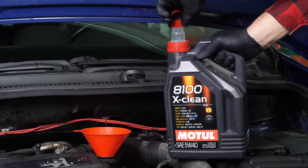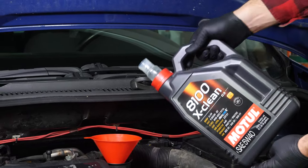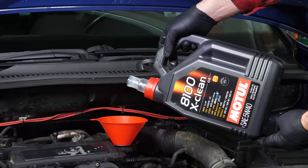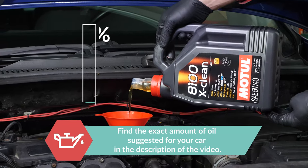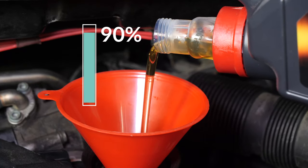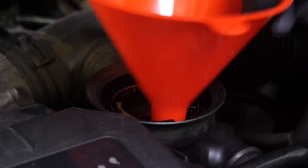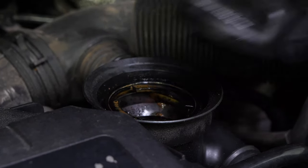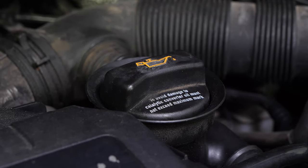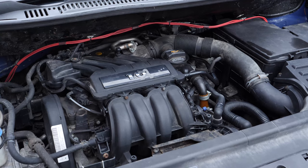Begin by putting in 90% of the suggested amount. This will leave you a large enough margin to adjust the level of oil appropriately. You can find the exact amount of oil suggested for your car in the description of the tutorial. Close the oil fill plug, start the engine and let the car run for 30 seconds. This will fill the oil filter.